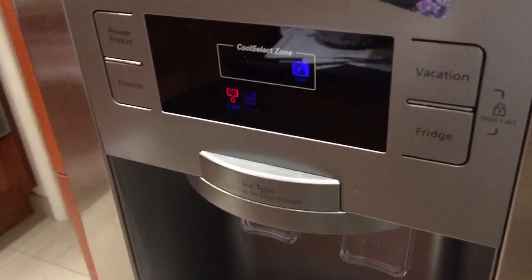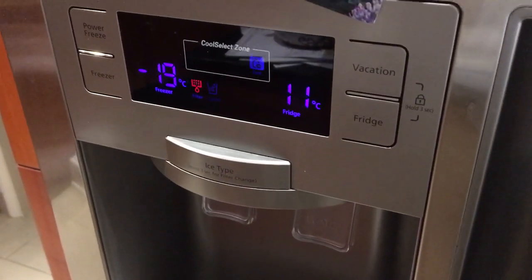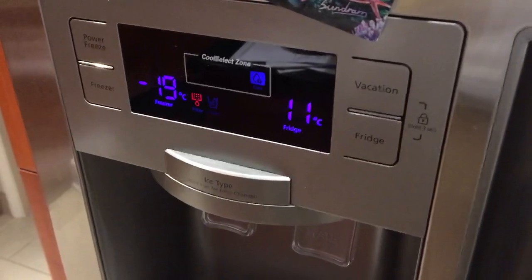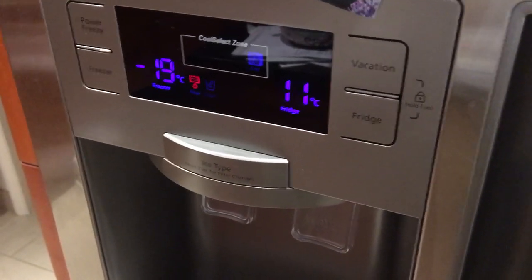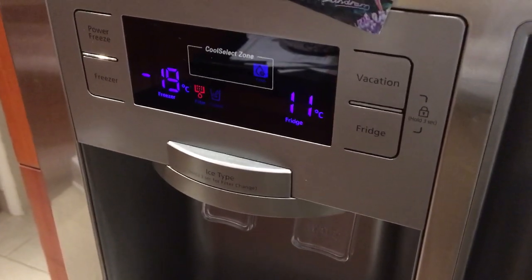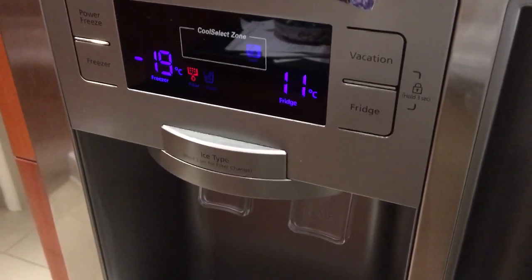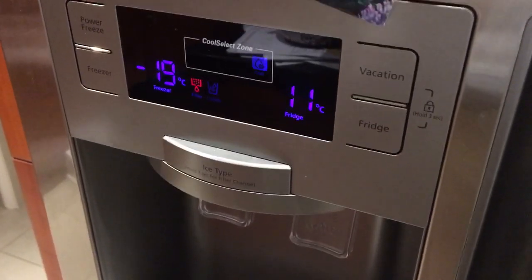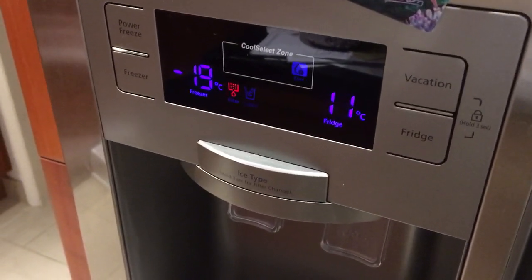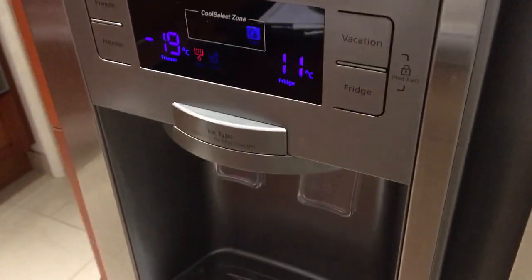You might have noticed as well, I've got to open the door to get the temperature back up. Look how warm the fridge is — 11 degrees. That's because when that little switch is not turning the light off and the alarm is going — diding — it's also telling the control board to not begin the cooling cycle. So a simple thing as that little magnetic switch not working is going to stop your fridge freezer working.